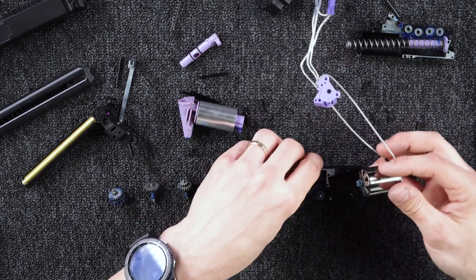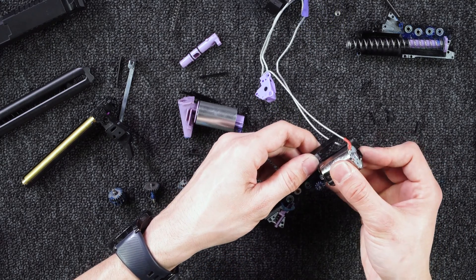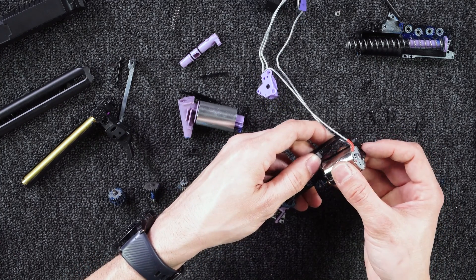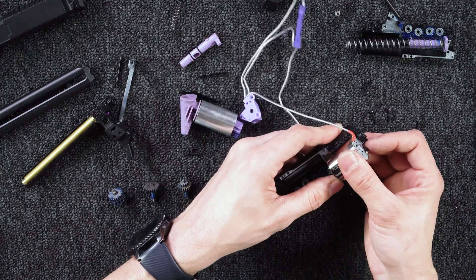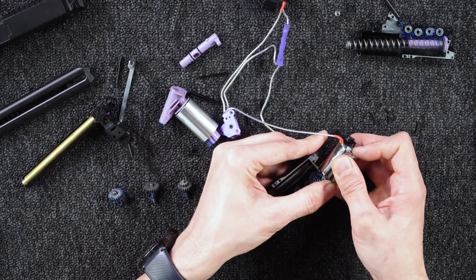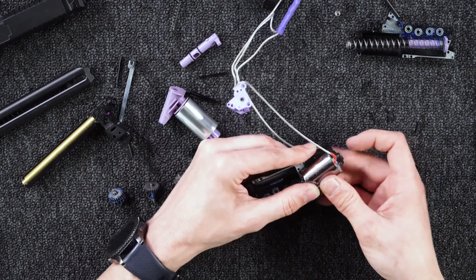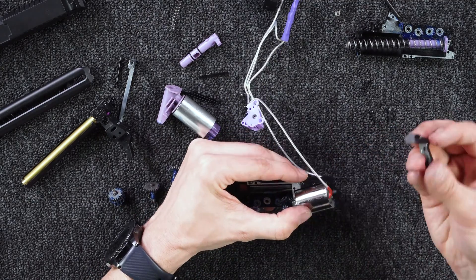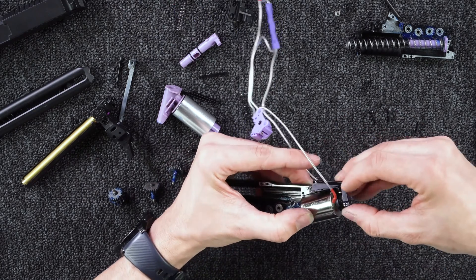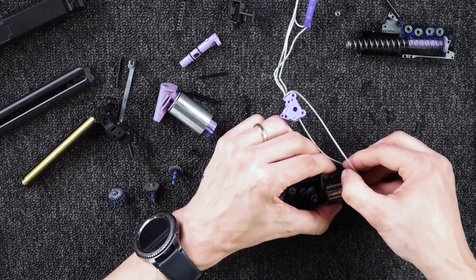Then we will put the motor back in again, remembering to rotate. Push the front down first, and compress this little crown spring that it has on the front of it. This can be a little bit fiddly — you need to just secure all the parts with your fingers so that they don't fly off in any direction. Once it's pushed in, I can rotate the motor, and then I can secure it with this part and align this pin so that it captures the motor. You can actually rotate it the other way so that it's a little bit easier, and then finally put it in the final position.